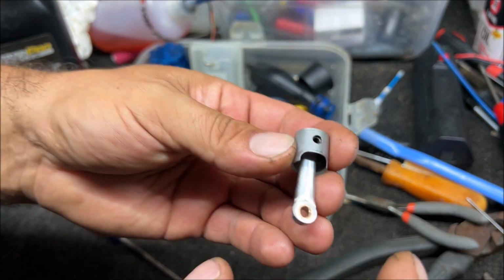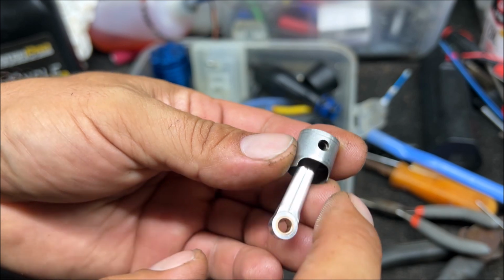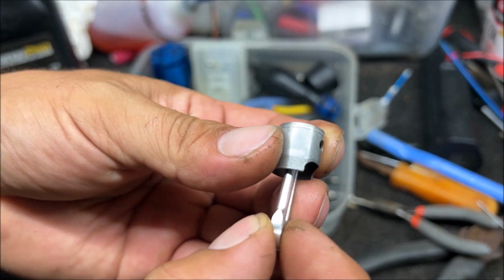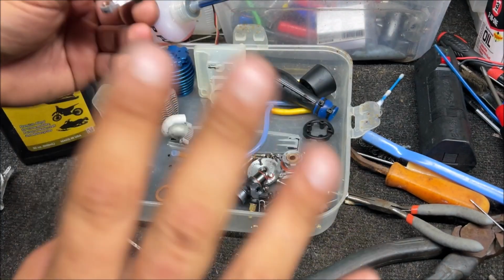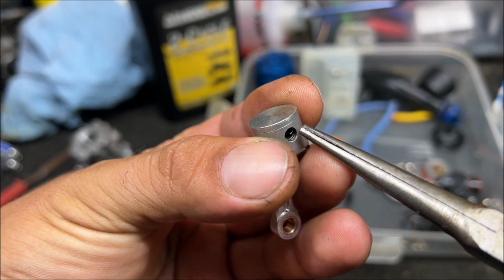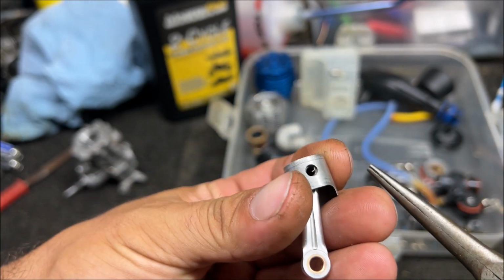So remember, C. We got the curvy bevel on the bearing, we have the curvy cutout on the piston, and we have the curly Q little clip. And then it goes to the crank side. And the last thing you want to do is forget the orientation of this stuff. So now I'm gonna cut the camera off because I gotta get that little clip in there. All right, so I just grabbed a little clip with some needle nose pliers that fit in that hole. You just kind of roll it or spin it in there and you'll hear it snap.